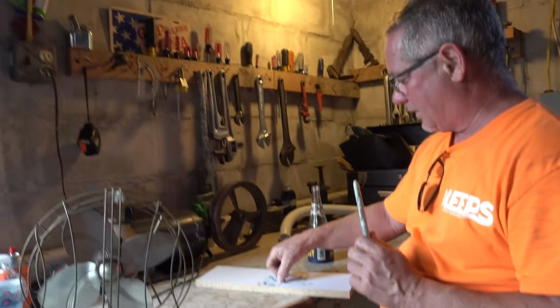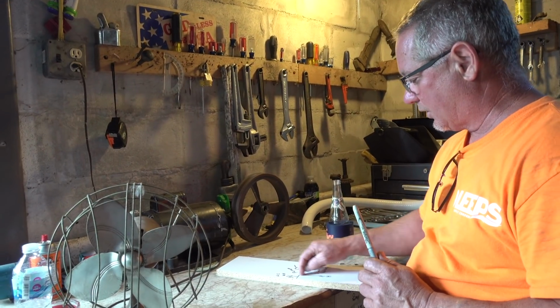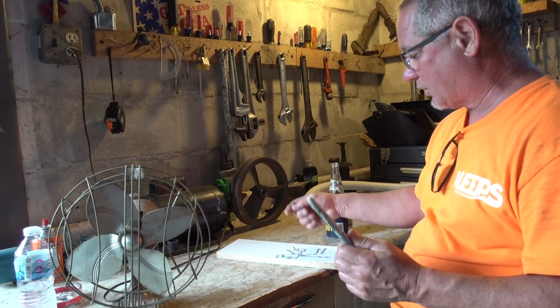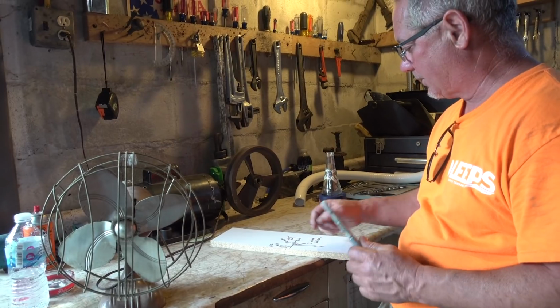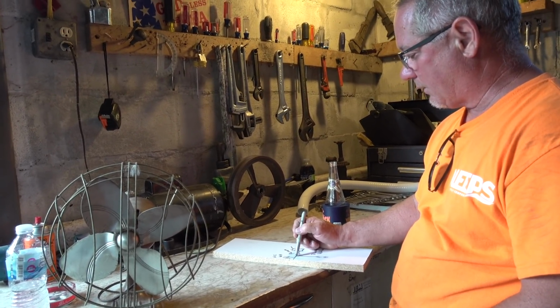You have to separate the pump and the accumulator and the storage tank from the city water. So this is pressurized, this is suction, this is actually creating the pressure. So right here at this T is where you have to have the 3-way valve. You can choose, basically. If you're running city water, it creates its own pressure. It's already pressurized water, so you don't need your pump. So you're bypassing your pump, and it just runs straight through your lines, and then you flip that valve when you want to run off your tank and your pump.